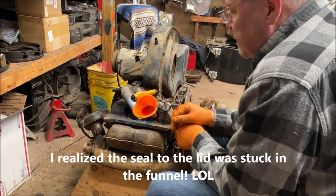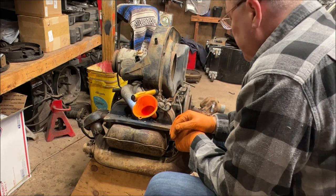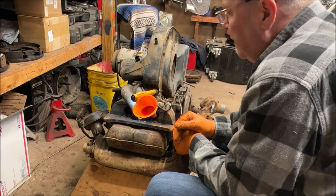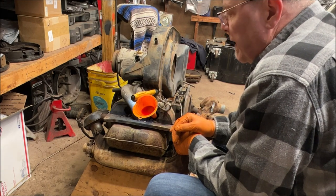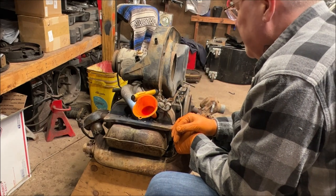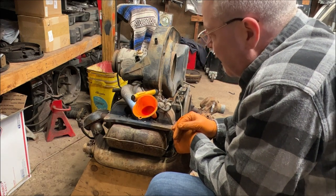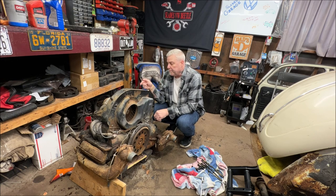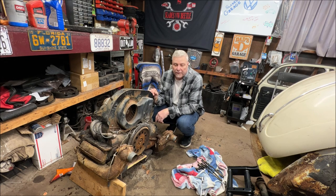We're going to fill this side up and let it sit for 24 hours, then try to turn it once more. If it doesn't turn, game on — we're just going to start ripping it all down and split the case. If I have to beat on the jugs to free the pistons, it really isn't a big deal because I'm going to be rebuilding it anyhow. I also poured more down the distributor drive gear and put some brake fluid down there. In 24 more hours we're going to try to break it free — if not, we're going to strip everything down and not wait around.